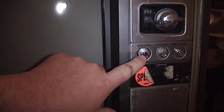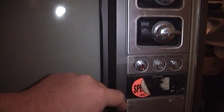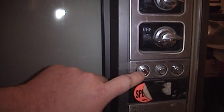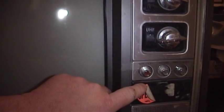The only other problem this television has had — you might notice there's a control with a red dot in the middle here. This is the automatic picture control; it controls the color level, brightness, things like that. Some televisions use sophisticated means to adjust the picture automatically. Zenith used a photocell during some of the 1980s on their System 3 sets. I don't think this TV does anything so fancy, but as what may be yet another result of components that have shifted in value, attempts to turn that on result in a severely oversaturated picture, and have done so for as long as I could remember.